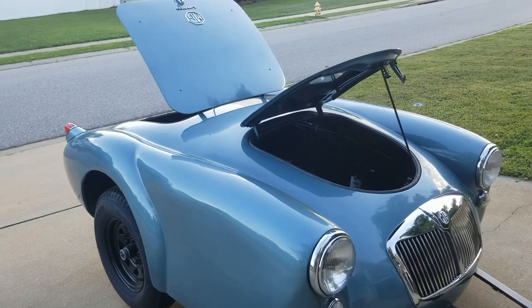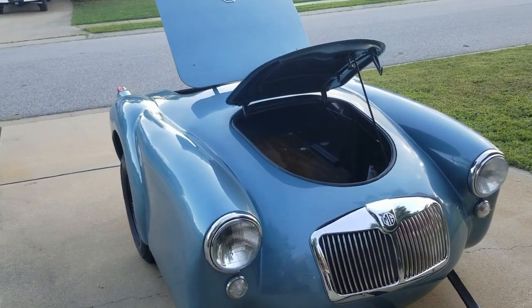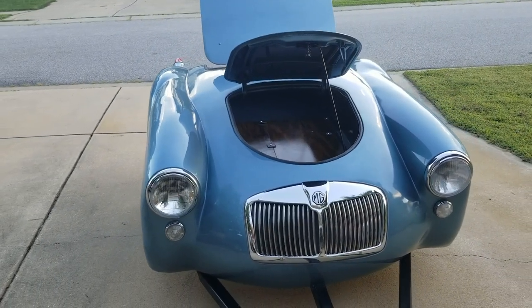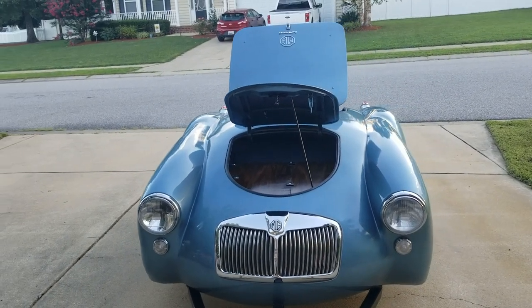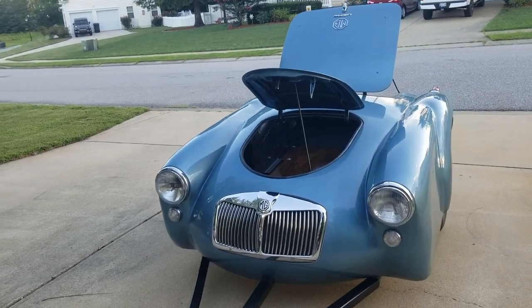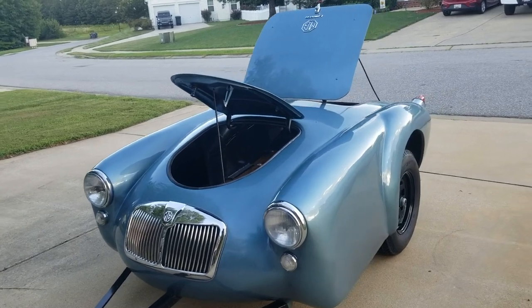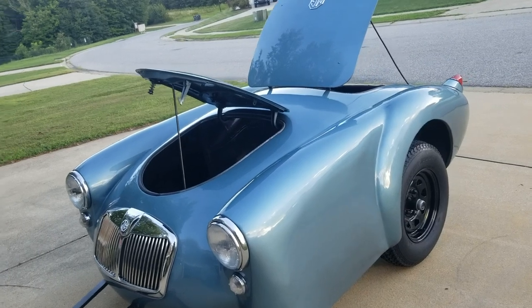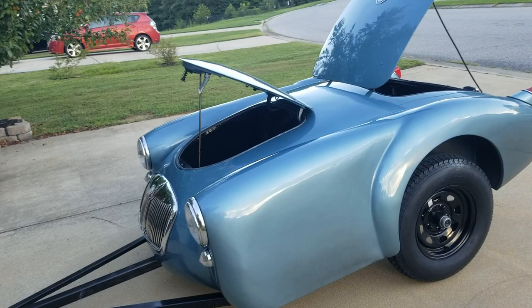I know this because having been in and out of this thing countless times, and being a barrel-chested German, it never complained. It's really well built, I think. The front tow bar extends all the way to the rear of the trailer and was both notched and welded, as were the front diagonal stabilizing pieces. Okay, so this means that front tow bar goes all the way to the back and has load bearing on the entire length of this trailer. Again, it's stout. Everything was notched and welded, as were the front diagonal stabilizing pieces, as I mentioned.